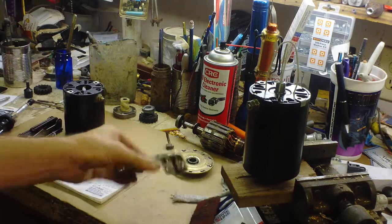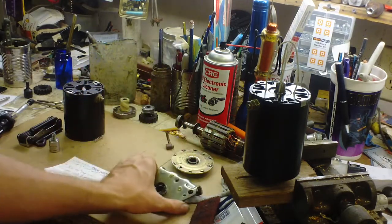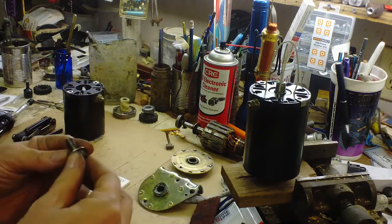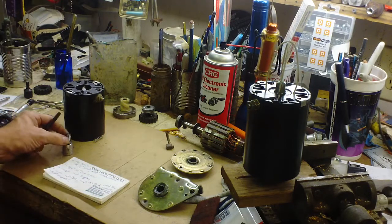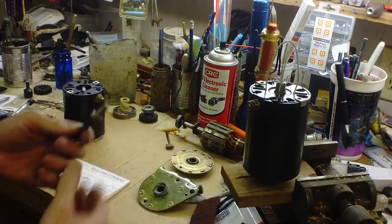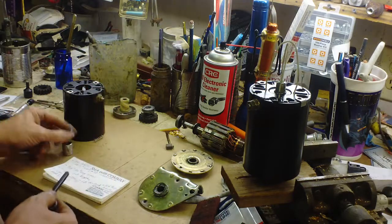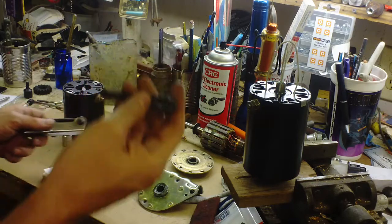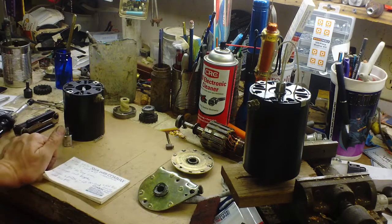This kind uses two bolts - it bolts on to the block like this. The bolts are just these little bitty ones; you've got to have a T40 torx or star bit for these, or a half-inch socket. But it's pretty tight in there, at least on one of them, so the socket doesn't seem like it's gonna fit. I actually had to take this thing off and go to the store to get a better bit. I use a quarter-inch drive ratchet.